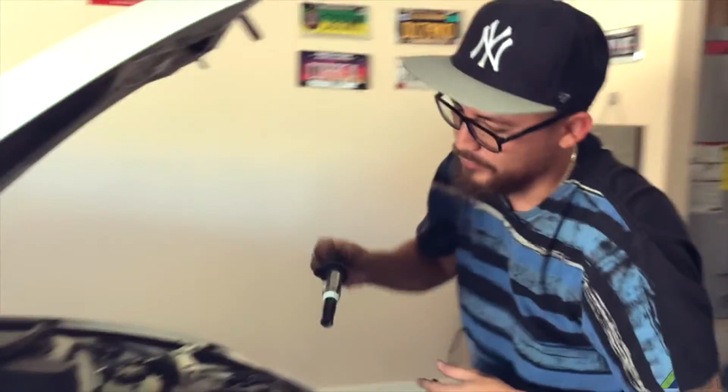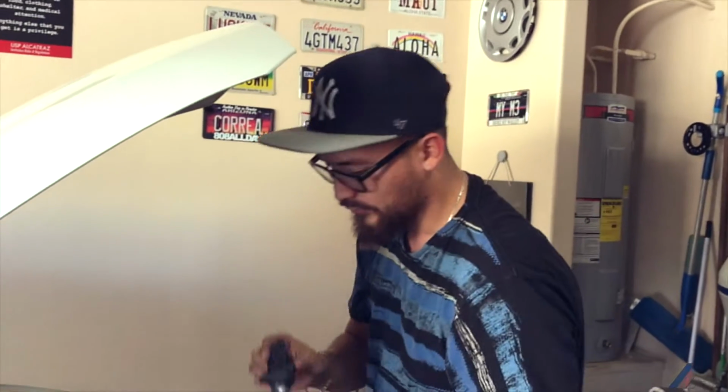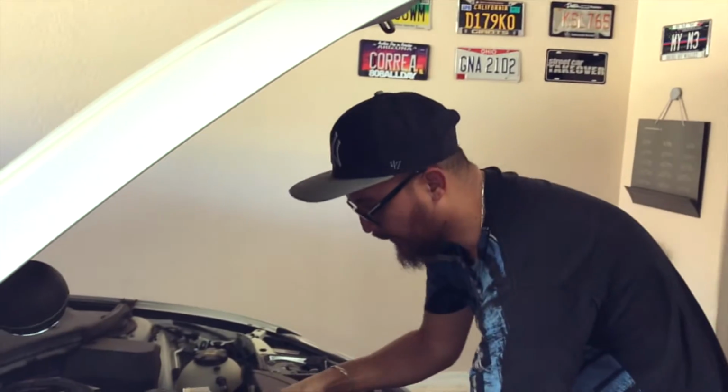Alright guys, so when removing your coil, you wanna inspect it. I know this is a brand new car, or kind of brand newish, 2014. You might not experience any type of damage here, but this is something you wanna look into. Want to make sure that it's not broken into pieces, if there's any type of oil, all that type of stuff is something that you just want to take a look into, okay? So far, dry, everything looks pretty good, not bad. So you have a really good coil, that's all for right now.